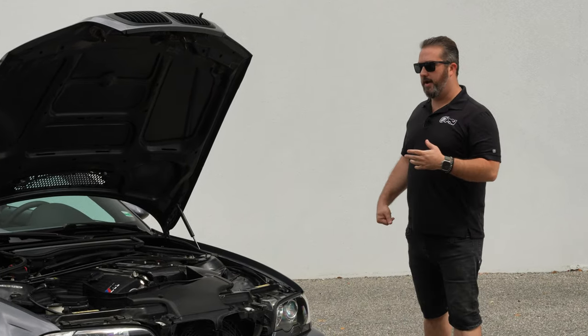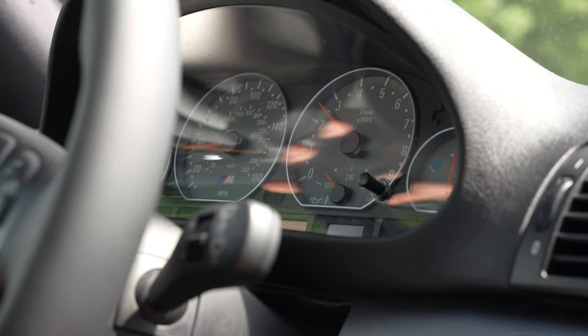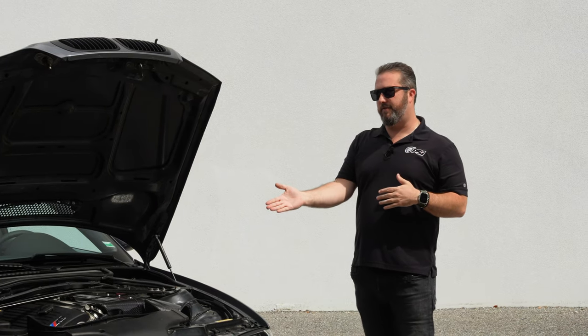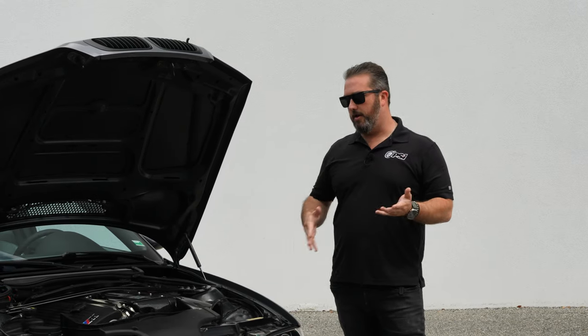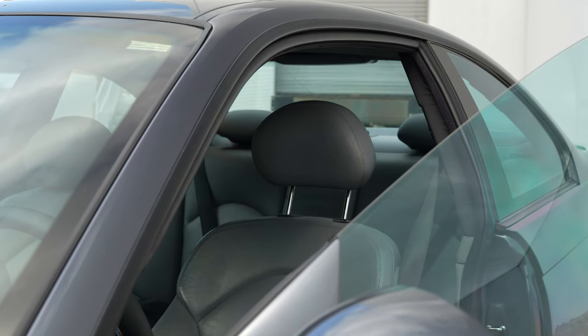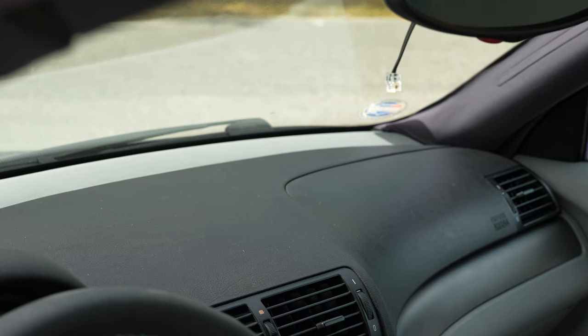The other thing I wanted to point out: the car had a really dancing idle. At idle it would bounce from around 900 up to 1500 — the idle would move — and it was a constant issue for this customer. He had the box and stuff done at a shop in Kentucky, and they did a great job on the car, but there was always that idle issue and always kind of a running richness to the car. So one of the things we did was we retuned it with Active.